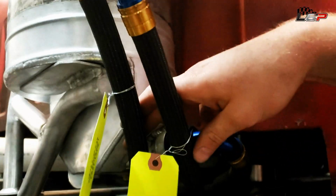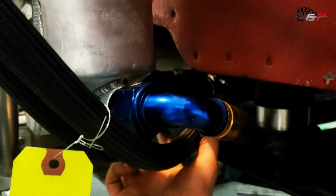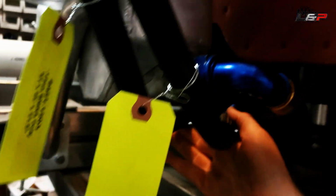So I just need to 3D print some spacers here, probably out of polycarbonate so they can handle the temperature, and then make some mounts so this piping is nice in this free space and none of the tubing is touching anything. If I do this right, I can print some spacers and get this nice and parallel. I just might have to scooch this one back a little bit. Yeah, somewhere about there. Should be able to get nice parallel feeds.